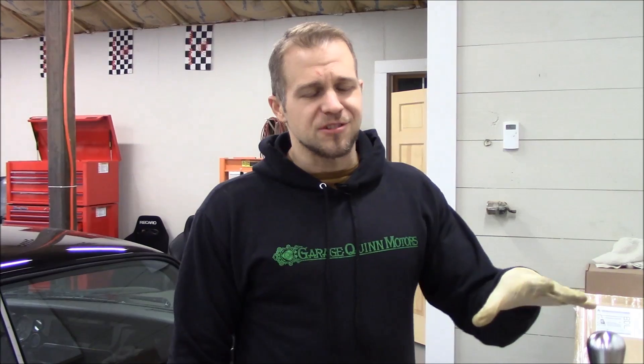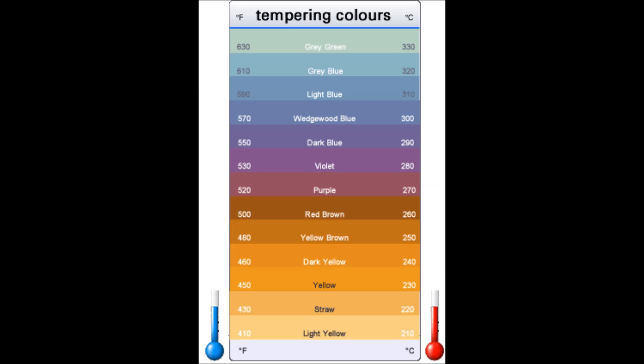I haven't done this before on a shift knob. Before we shot this video, we did a little test run burning the tips from an old exhaust tip and it seemed to come out okay. I didn't prep the surface as much for oil and grime, so the finish didn't look that great, but the color changes were there. As you heat the metal up, it will start to change from silver to a goldish brown, then to a purple, and then when you get it hot enough, dark blue to a light blue. I didn't go past that point because I think that's about where it stops — it might go to teal if you can get it hot enough, but with the propane torch we're using here I couldn't really get it that hot.